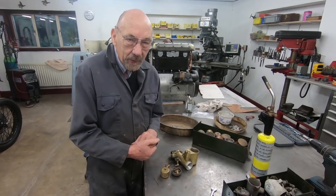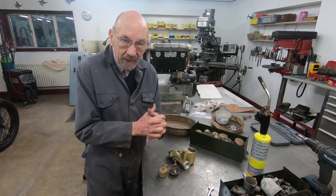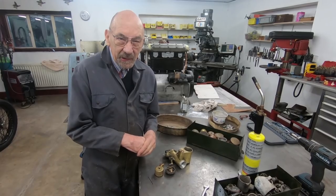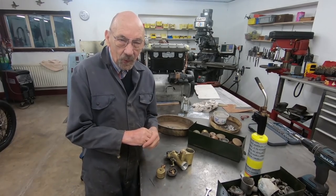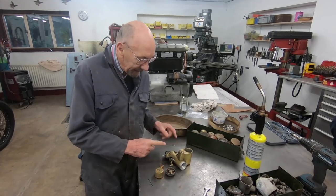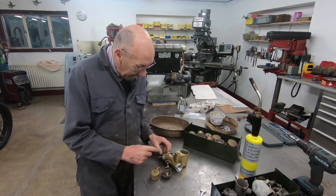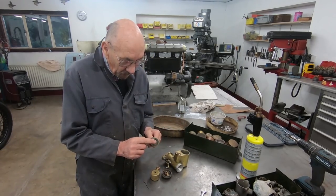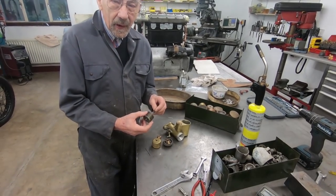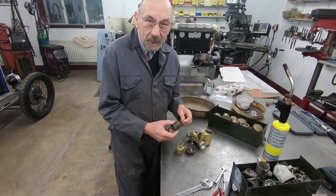So that's it. Now we're going to go and look at my Skiro, which has got a 1000cc racing Jap in it and two beautiful GP carburettors. We're going to take one to pieces so we can carefully look at it, because obviously the angle of that, but the other way round, is very important. And Amal probably did a load of research, so we're best to copy an Amal, really.